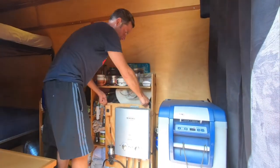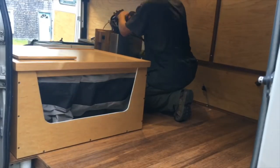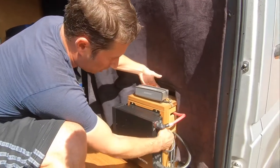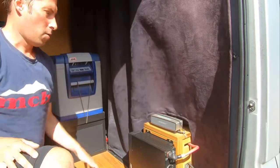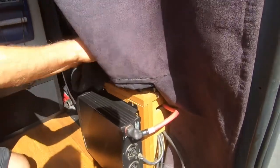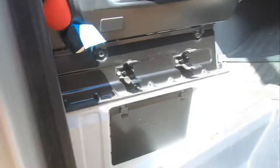The whole water heater can lift right out. You'll see in other pictures, I have a 40-gallon water tank in the middle and the heater just sits on it. Right here I have a 2,000-watt inverter. Inside this box is housed a charge controller for 120 volts, and I have a plug on the back left side which feeds into this and allows it to charge the house batteries. I have toggles here — I can latch here and I have another one on the other side. The toggles allow you to take the headrest off and open it right up.